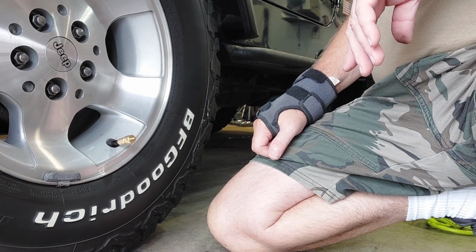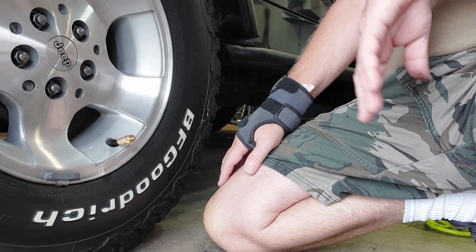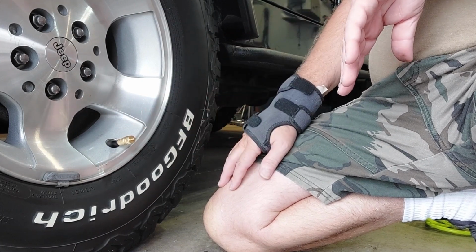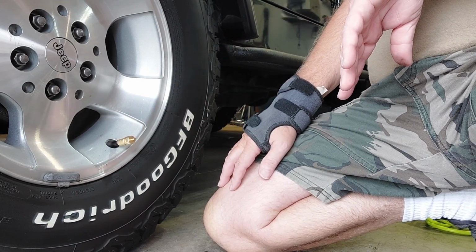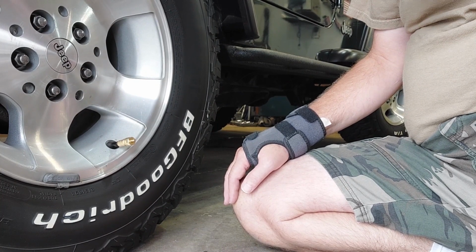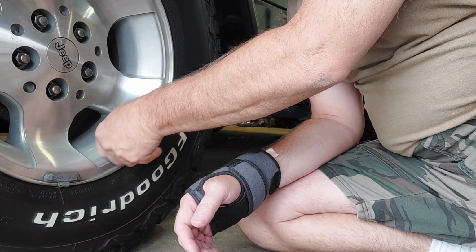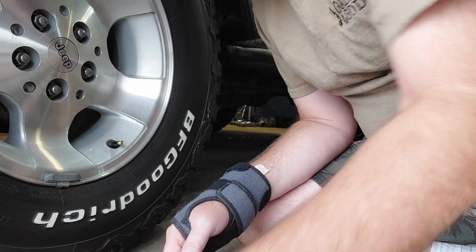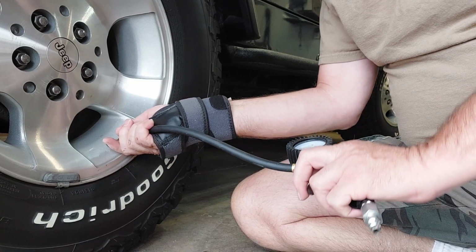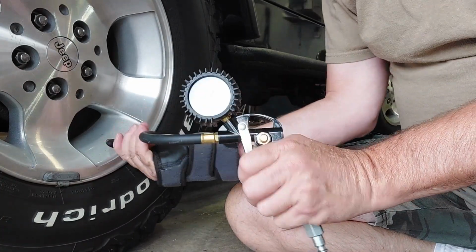And here, slow down a little bit. As the air pressure gets lower, the air comes out slower. But remember now, we're doing all four at once this way because we put these on all four when we're out at the woods. Boop. See that? It went off. So now this tire's been lowered. So we can take this off. We'll put that with our ones that are adjusted. We'll put this back on, show you what we did. Look what we did. There we are. We're down right at 20 pounds.